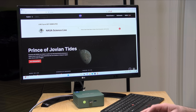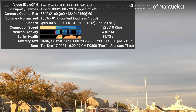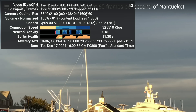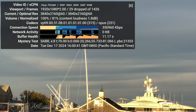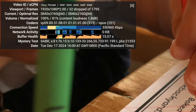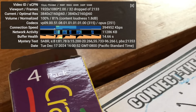A little bit earlier I ran my 4K60 frames per second video test. There were a couple of dropped frames when it first started and then it settled down, with one or two other dropped frames as the video was playing — nothing out of the ordinary, possibly triggered by a dialog box that had popped up. By and large, this performs as nicely as the other version does at video decoding and encoding. If you're using this as a Plex server, these Intel N100 and now N150 chips are very well suited for that purpose.